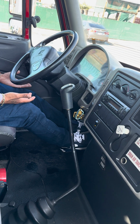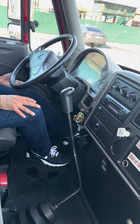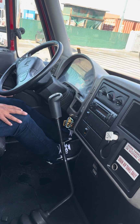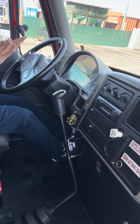And this time I'll be hovering over my steering wheel. I'm gonna go forward, let go of the service brake, and let go of the clutch slowly. We're gonna start moving forward. I'm gonna press on the clutch and brake at the same time. It's gonna stop. That means my brakes are working properly. My steering wheel did not move left and right.